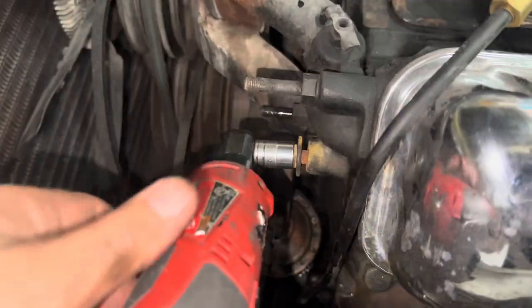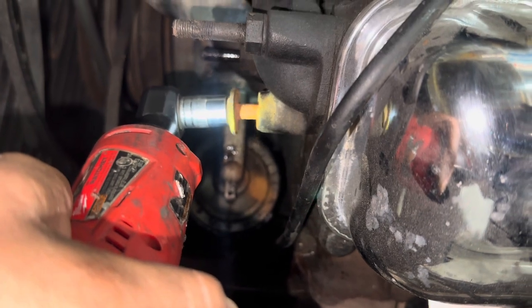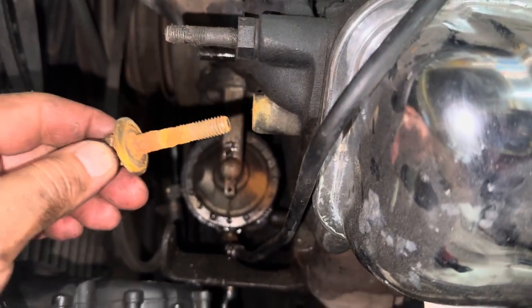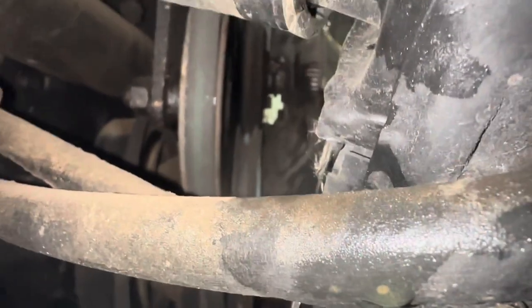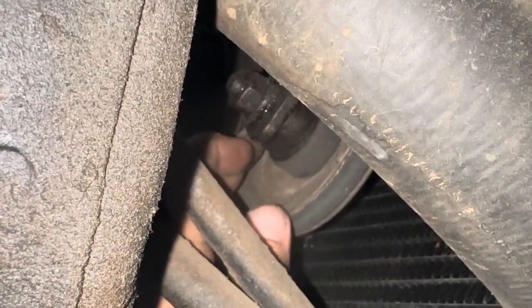Plugging away. I started pulling up this water crossover bolt — look at the corrosion. Oh my God. Down below getting ready to pull the lower hose and undo this idler slash tensioner for the AC. The bearing on the back side of that idler is coming apart — that's not good, and that also explains the greasy mess.